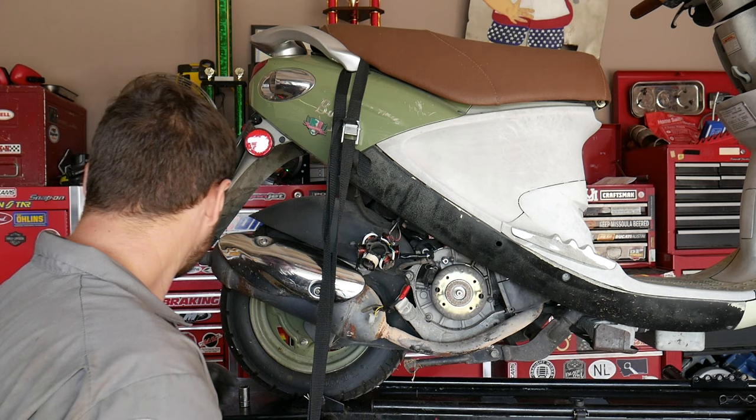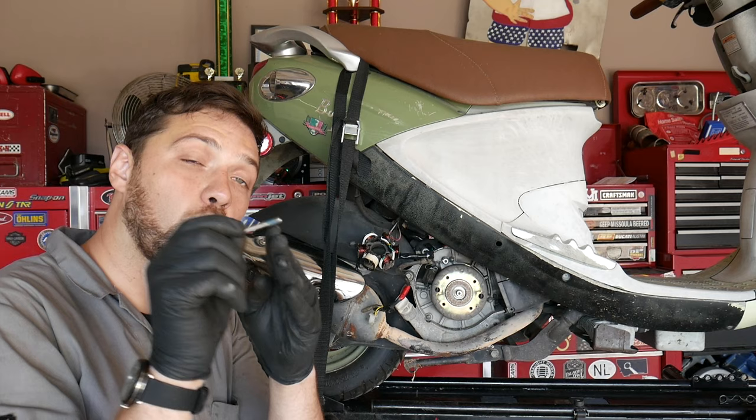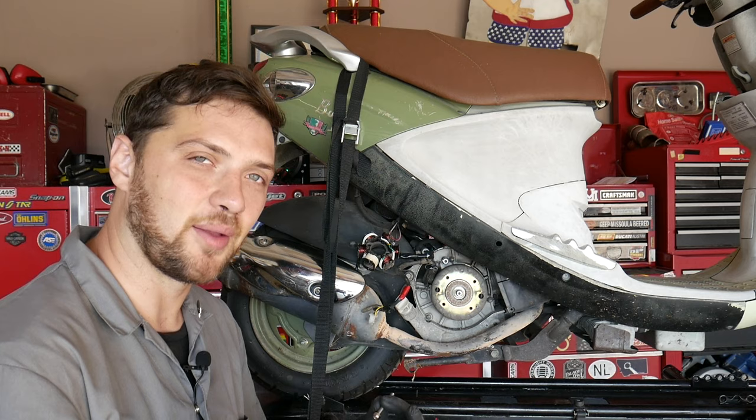What we're gonna do is install our 6mm by 1.0 bolts back into the flywheel, and we're actually gonna run them all the way through. So what's gonna happen is they're gonna run into the stator and start pushing off the stator, pushing the flywheel out. Now, again, I don't recommend doing this. This is not a good way to do it. It's not the correct way, but it is a way if you're stuck in a jam. So, without further ado,